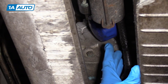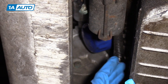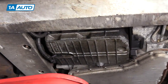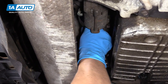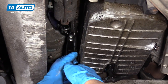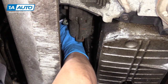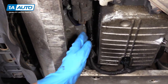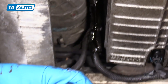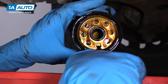Next I'm going to take the oil filter off. Because this engine is a 3.4 liter engine, the oil filter is located right here in front of the motor. If you had the Chevy Impala with a 3.8 liter, the oil filter would be right here — but because it's the 3.4, it's located in front of the engine. I'm going to use a strap wrench to loosen up the oil filter. Just put it on, and once it's on properly, just loosen it up. Once it's loose, I can take it off by hand. It is going to start dripping, so make sure you have your drain bucket underneath. Drain the oil out.